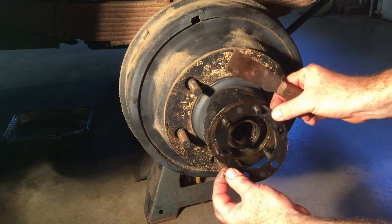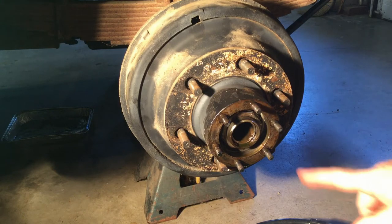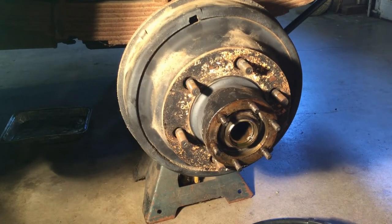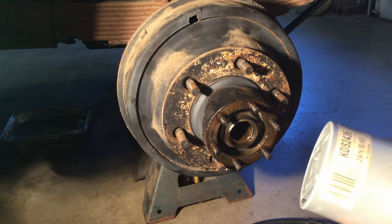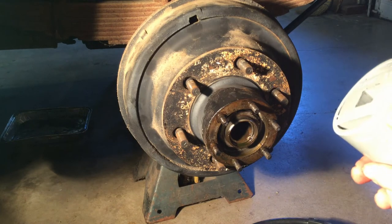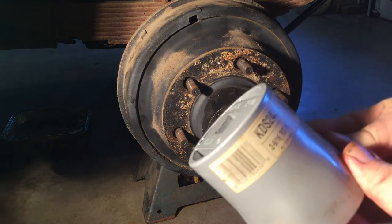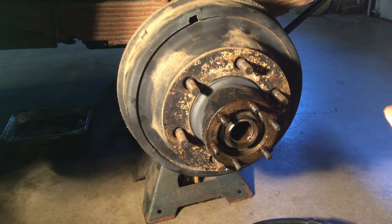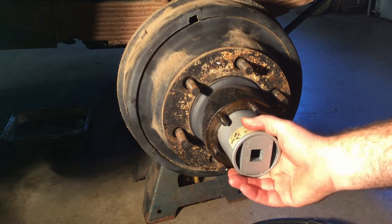This will get new gaskets because I don't want an axle leak getting on my fancy wheels. Looking inside, you'll see a nut. Two years ago when I first got into this, it was a two and nine-sixteenth nut. I went to the local parts store and said I need to pull off a two and nine-sixteenth axle nut, and they handed me an axle nut tool. I bought it without thinking, but for some reason it doesn't quite fit right.